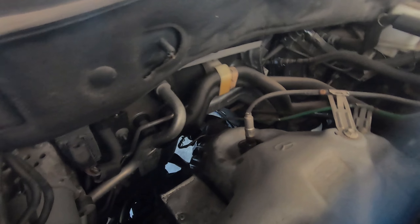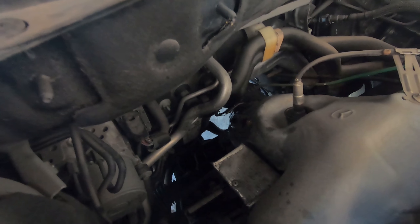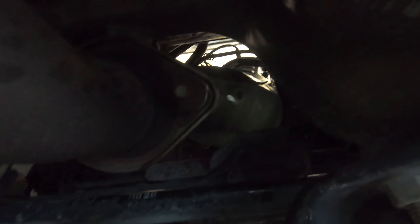It's got that pigtail wire holding it off the exhaust, so you just kind of wrap it through there, and the connector is over here. We'll reach up from underneath - you can see that hole down there - and get this out. Here's the old one. Looks like they all do, since it's after the catalytic converter. We'll go up top, pull it out, put the new one in. There's not much to show since you can't really see anything and it's pretty quick. One thing you always want to remember is if you put oil on somebody's exhaust, warn them that their car is going to smoke afterwards - I've had people freak out about that.